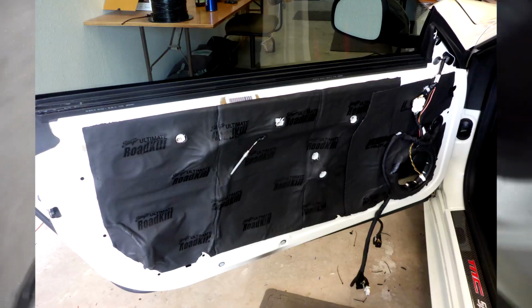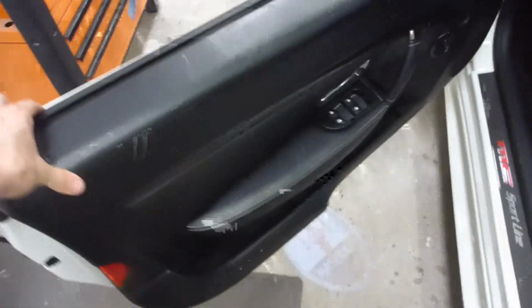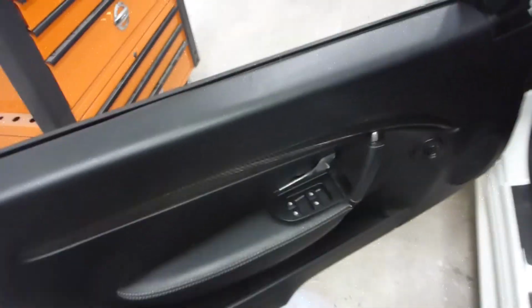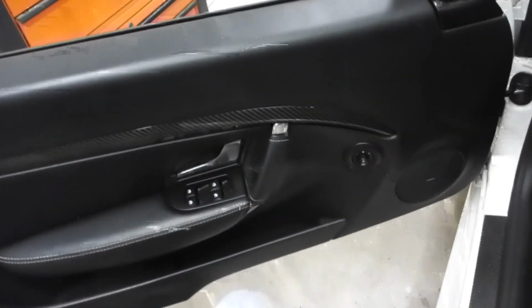The door panels are pretty straightforward. So the outside, it's all been sound deadened, and the inside door skin as well. There's a little video on all that work. I did puddle lights, so that has a cool little glow of the Maserati emblem on the ground now. Let's see, the Focal Flax Series 6.5-inch woofers go there. I replaced the Bose emblem with a Focal logo. It's got the fast rings to couple it to the door.